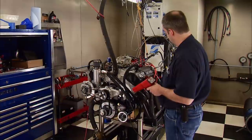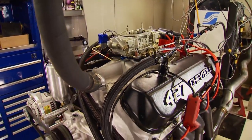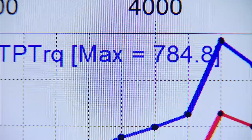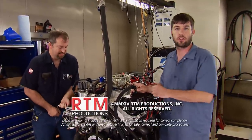Let's tune on it a little bit more — keep the same shot and add some timing. We definitely got enough octane to do it now. 669 horsepower, 784 foot-pounds. Look how much power it carries through the mid-range and it doesn't drop. We made 200 horsepower over the baseline in crate form with our little 427. That was with a 150 shot of nitrous and our race gas, which let us keep the timing in it — and the air fuels look great, telling us it worked. The next time you see this thing, it's going to be between the frame rails of our little S10.